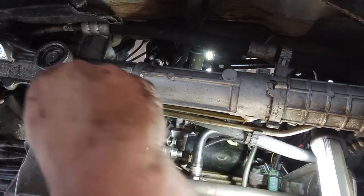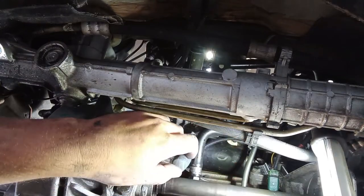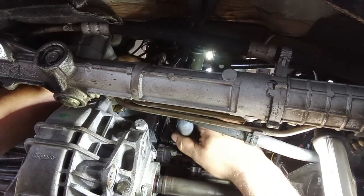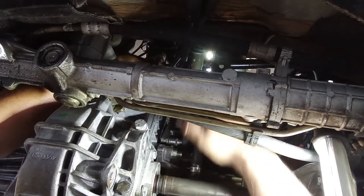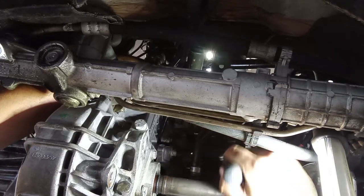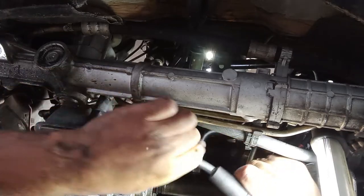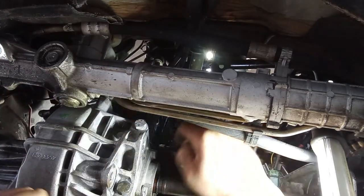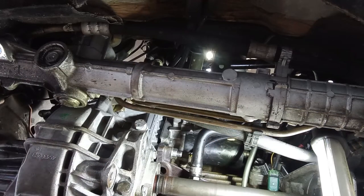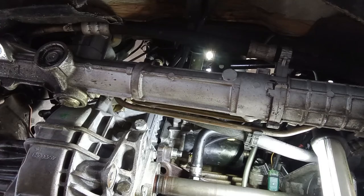This bolt over here, it is not necessary to tighten all the way, but it has to be very near, so the starter is in a position that is easier to work above. I already have the support that was missing, and also the bolt that was missing too. So I will assemble that in a minute, making sure that the guide is not crooked. It's not. Now, like I showed you on the starter of the Fiat Linea, I will not tighten all the way because it will rotate on itself in order for the bolts to go in smoothly.